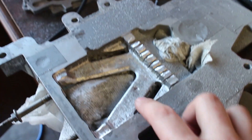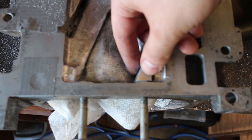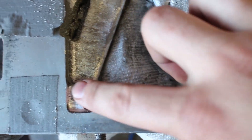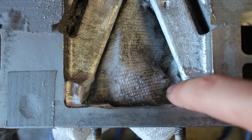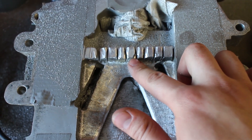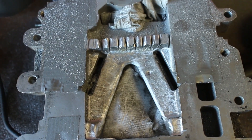Alright, just filming an update with the porting process. I went and polished up everything — the outlet, and also these little chunks over here. I cut these off. Ideally we'd like to bring these all the way down, but it's a lot of metal and it's going to take forever. This is really all that you need to do — open it up so it makes a V shape a bit. I started cutting these up and now I'm going to grind them down. Like I said, it just opens up and you remove this bridge so it's able to push air farther into the intake manifold.